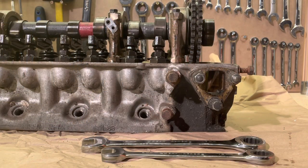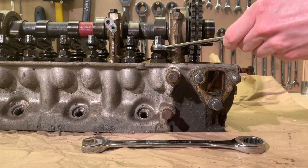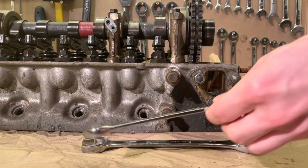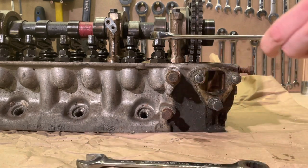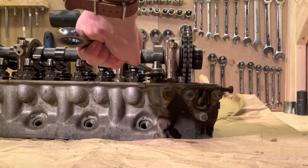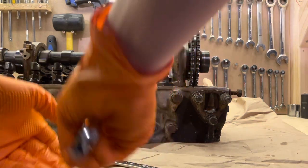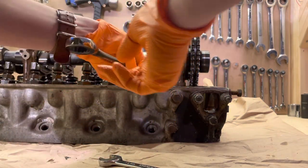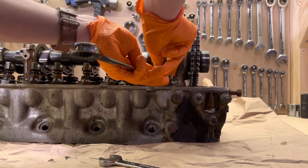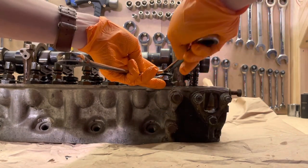What we want to do here is take a 14mm open end wrench, which fits on the rocker pivot, and a 17mm open end wrench, which fits on the lash adjuster lock nut. Take your 17mm wrench and first just loosen the lock nut. With the lock nut loosened, hold it in place with the 17mm wrench and then take your 14mm wrench and thread that pivot down as far into the cylinder head as you can.